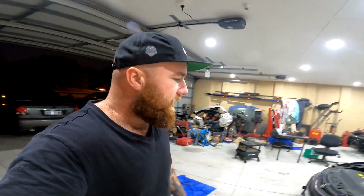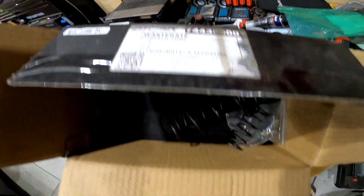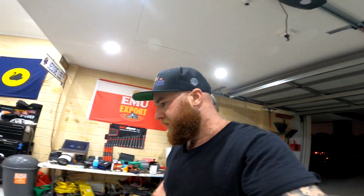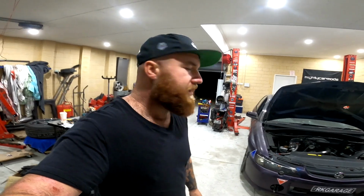I've got no idea about the wastegate spring that's in it. The box says it's 17 psi default, and it also comes with a 7 and a 14. But on their website it says 3.5, 5 and 7 psi springs. So who knows, I won't really know until I try. If I see it start to go crazy high in boost, then I might have to try pull the gate off, which will suck, and change the spring. If it doesn't make that much boost, that's fine. I can deal with it for a night without that until I get a boost tee, unless I manage to find one quickly tomorrow, which I doubt.